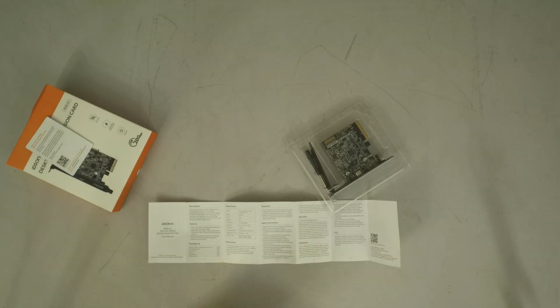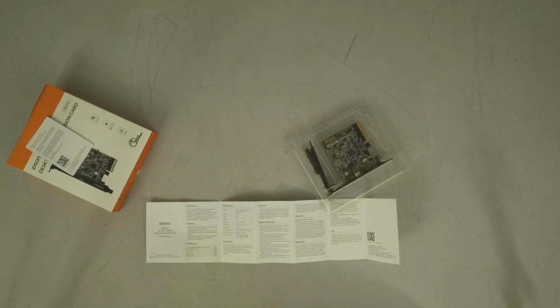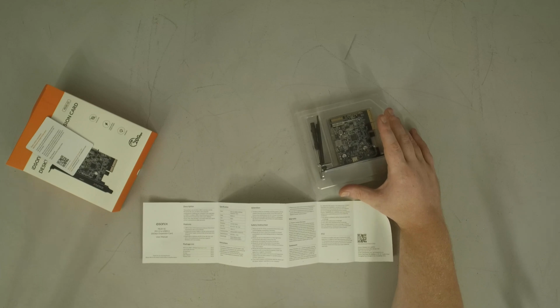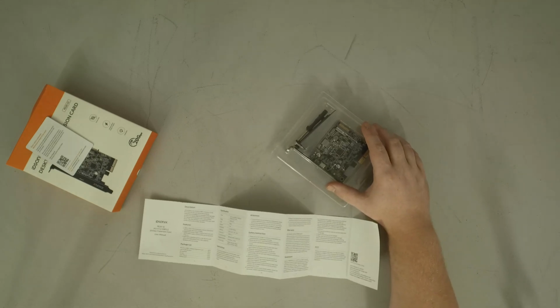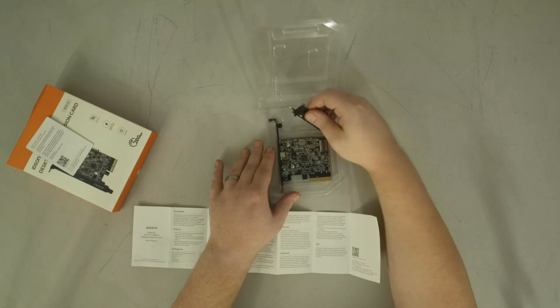Quick math, this is a PCIe 4X device. A 3.0 lane, if memory serves, can transfer about 5 gigs. So, in fact, you know what, let me just look it up, make sure that I'm right there. No, 3.0 is 8 gigatransfers per second, 2.0 is 5 gigatransfers per second. Okay, so this should theoretically run at full speed on a 2.0 x4 slot. However, there's going to be a little overhead, and I think this is actually a 3.0 device, so you're going to get your best results on a 3.0 slot. PCIe 1.1, don't even bother.